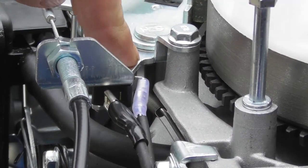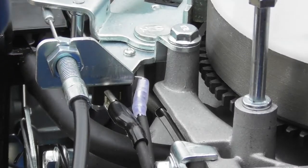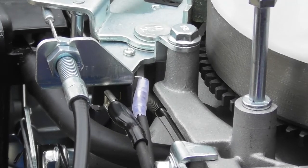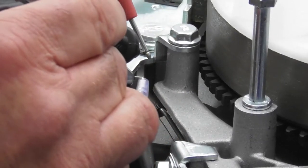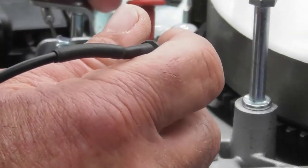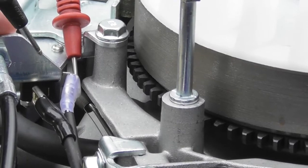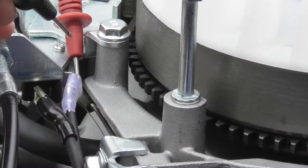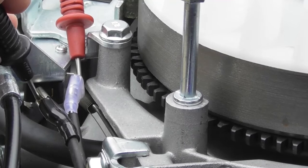So we need to know that this switch, when the OPC lever is pulled, is making a circuit. I can do that with just a beep test again. So I've got my multimeter somewhere handy. With the lever not pulled, I should get nothing there. As you can see, if there was a circuit I'd get a beep, and I have nothing. So let's try it when I pull the OPC lever. Let's see if I can just get these fastened in here. I appreciate I can't do this on voltage single-handed because I've got to pull the OPC lever and push the start button, and then I could test for 12 volts on this terminal. So all I can do is just check that I'm getting continuity. So a probe on each.